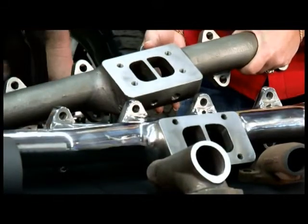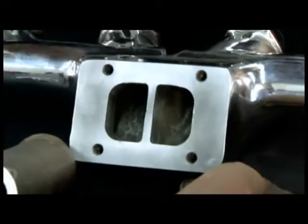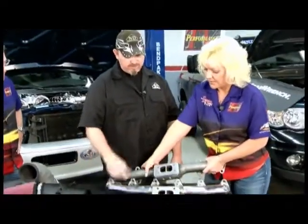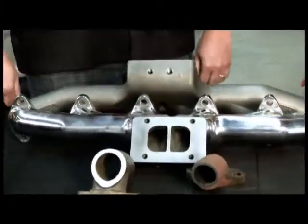When I look at the different footprints on these manifolds — this one's obviously smaller, this one's got a different hookup — it's just two different sizes. In the industry there's a T3, which is kind of the OEM size, and the T4, which would be your upgrade from that. There's also a T6, which is even larger. Based on what you've done on that truck over here, I've got another truck and I think we're just going to take it up one step.